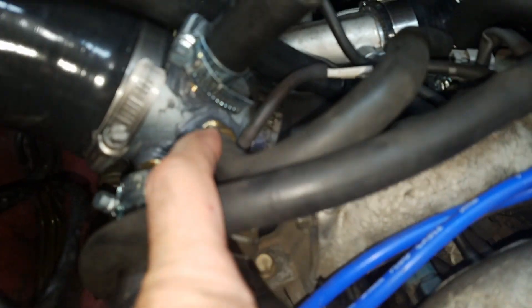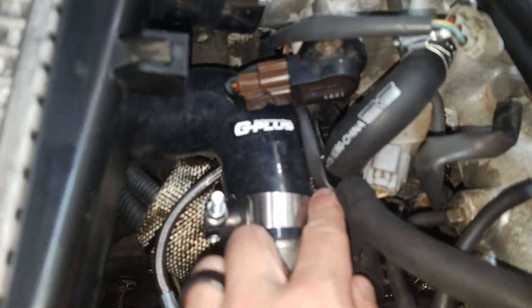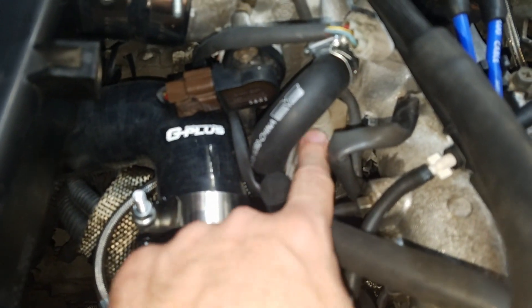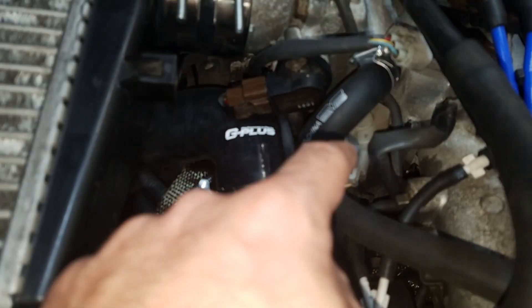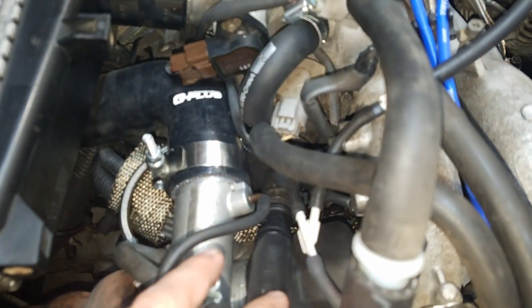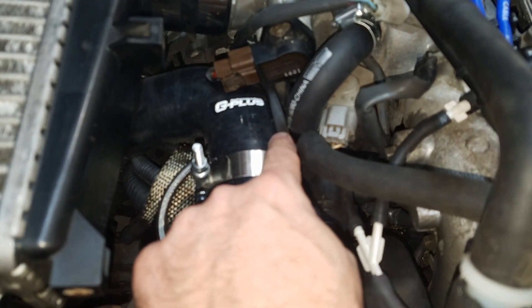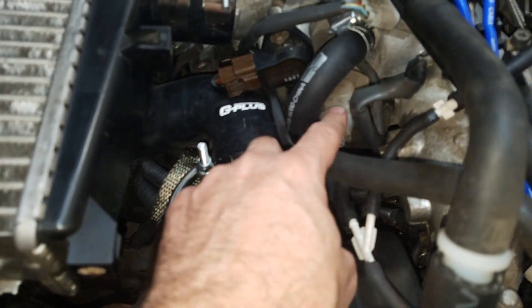Second one — this is going to be the half inch. Five-eighths, half-inch, five-eighths adapters. Half inch pipe all the way down to right here, and that's for the crankcase ventilation. I showed in the last video that I took the three-quarter inch pipe that was originally on this idle air control, which was about eight inches long, and took the one off the crankcase and replaced it with the one that was here. So it comes up to about right there. Then I cut the little excess that I had left and used it here.